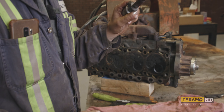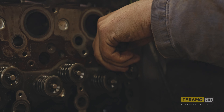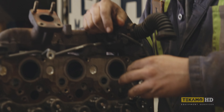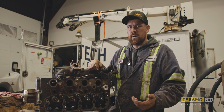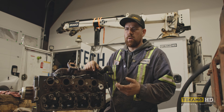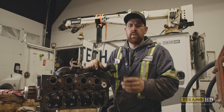It's not an easy thing to pull out. Normally there's a valve cover and a manifold in the way — there's just a lot in the way when you're taking these off. These are really stuck in there. If you can just get a straight shot to your injector — you'll have your DPF here, take that off, then hook your slide hammer for a nice straight shot. Either way, when you're doing injectors on these, you're going to have to do some teardown just to get to them. It's not like on a Cummins or a CAT where you just pull the valve cover and they're inside, soaked in oil their whole life — they don't really rust in place except for a little carbon on the bottom.